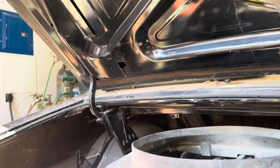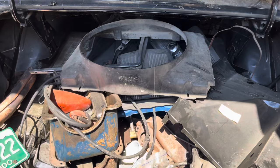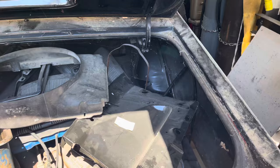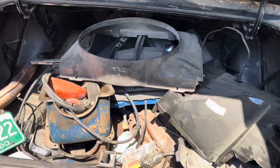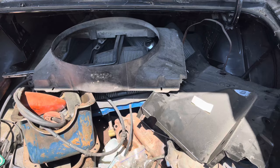Basically it's in good shape. This one has a little bit of bubbling right here — that'd be a fairly easy fix. It's just a puzzle. I had one guy look at it and give me an estimate to restore it — he wanted to do patch panels. I don't want patch panels because no matter what you do there's always going to be a seam on the inside. You'd have to paint and body work and undercoat over it — that's not the way it's supposed to be.